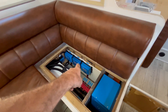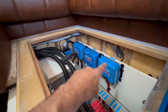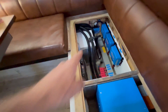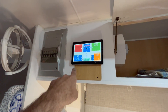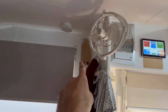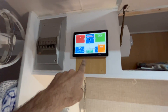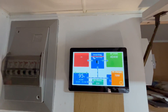There is a lot of solar as you can see — there are three solar controllers: a 50, a 30, and a 50. There's the Cerbo GX with a Touch 70. We have two Redarc DC chargers in this thing, so there's 80 amps of charge coming from the vehicle. We've done the Touch 70. You can see our mate's going to do some painting because the original solar controller was around there — that's been removed. This whole track has been painted, so that'll get painted. There are the PV breakers.